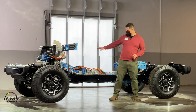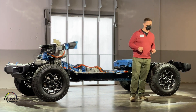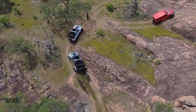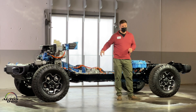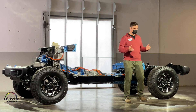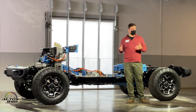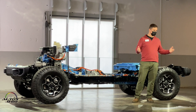Moving back into the transmission, the P2 motor is at the front of the transmission, and that's the primary electric drive motor in the car. That's the motor that can drive you right up at highway speeds — it can, in fact, do the entire Rubicon Trail with the engine shut down. There are a couple of clutches as well in the front of the transmission, and combined with some creative software, there are a lot of different modes this powertrain can operate in. Engine off, pure electric driving through the drivetrain is one of them. The engine and the electric motor can also work together — they can both drive the car, and that's how you get those big combined power numbers.